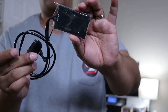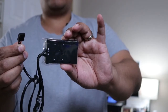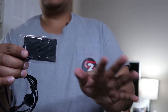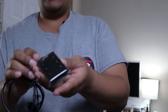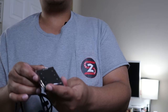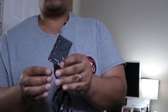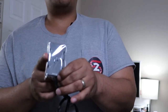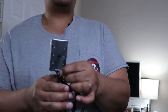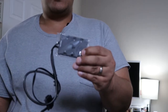So this module connects to one of my power cables on my power supply for power, and it also connects via USB to the computer so I can read it off my iCUE software. It'll be mounted on the back side of the PC — out of sight, out of mind. On the side you have plugs for the fans — you can connect up to six fans on one control module. I already have two installed on the PC, and I'm going to install three more, so all five fans will work off one module. It comes with double-sided tape so I can stick it somewhere in the back.